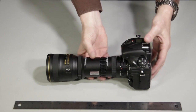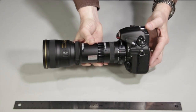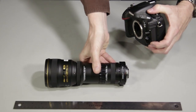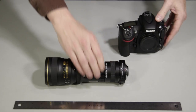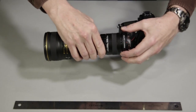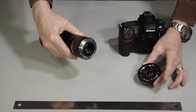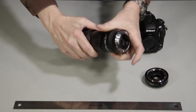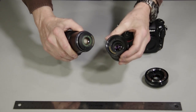The rugged Astroscope 9350 module fits between the camera body and the lens, and allows the camera to communicate and supply power to the lens, so that aperture, autofocus, and even optical image stabilization can be used. The various sections of the Astroscope usually remain together for easy attachment to the camera. The first shown here is the optional full-frame adapter for the Nikon D800, which gives you a larger image size to cover its full-frame sensor. On DSLRs with an APS-C size sensor, you start with the back body adapter, with two variations that allow you to mount the Astroscope to either Nikon or Canon DSLRs.